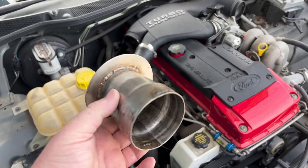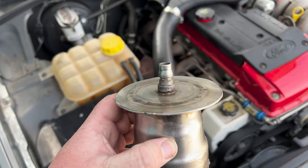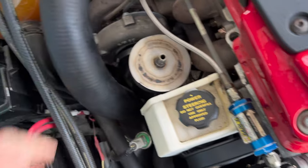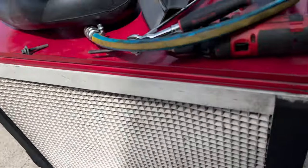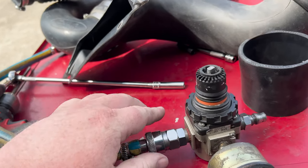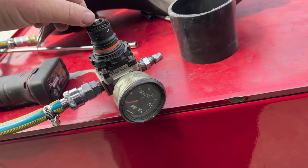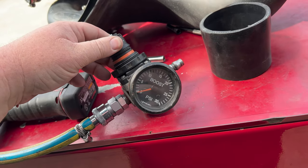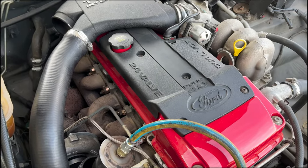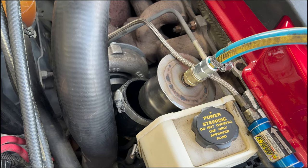We're dealing with some pretty high-tech gadgets here. A pipe with a Nitto fitting on it, which goes on here, clamps on. Then we got ourselves a pressure regulator, another Nitto fitting. Hook that to the front of the turbo, hook that to shop air, adjust the pressure, see how much we're leaking. So that was holding about 10-15 PSI, and the turbo was making a hell of a racket, but it ended up blowing the boost checker out of the front of the turbo.